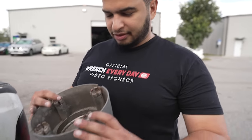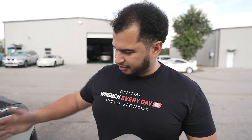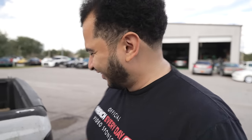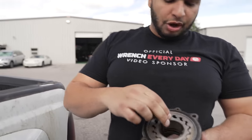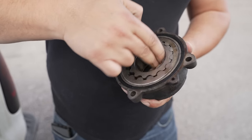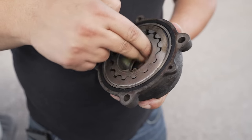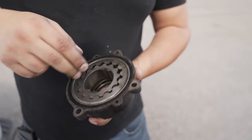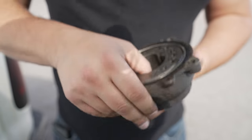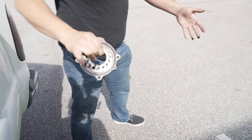So here is the old low pressure oil pump — what it does is it just goes around the crank like that and pumps oil through these little passageways, and that's how it creates oil pressure. I got a revised one that actually has less of these bumps, but they're more pronounced, so it can create a better oiling environment for our engine.